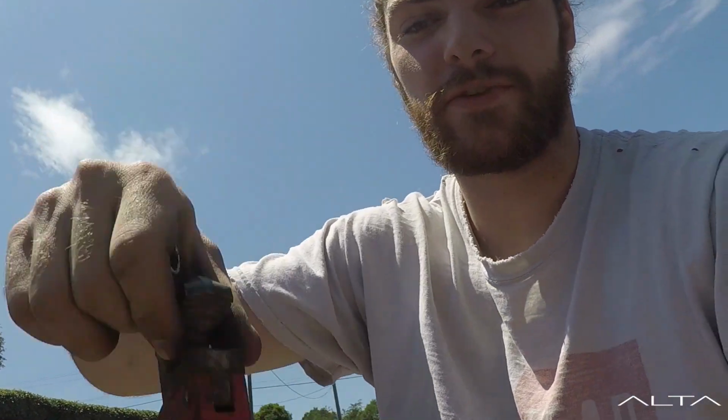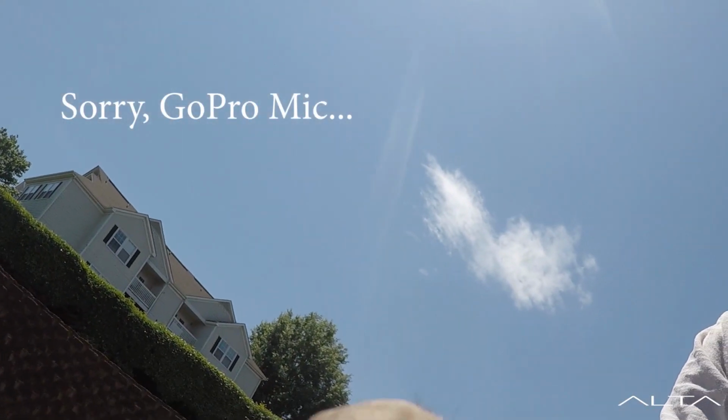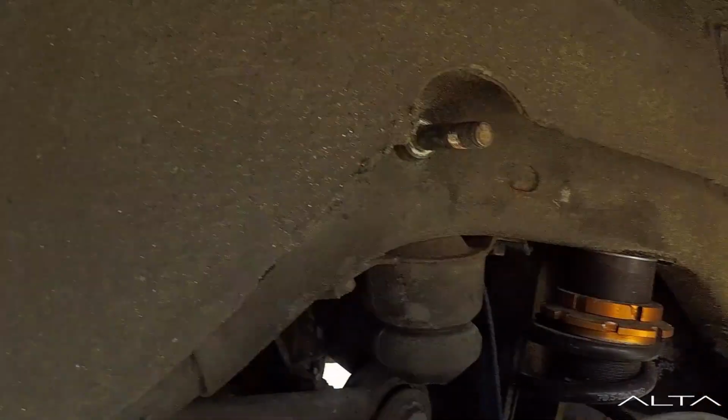Finally got that out. Ended up using a little pipe wrench to grip the sleeve and just twist it out. Once I got those out, I realized that the upper sleeve is pretty thick and too big, but the bushings that came with it are very, very close to the right height. The upper mount is just a threaded single shear bolt, while the lower has to be pinched between the two, so I need to use the lower mount, but the upper is less critical. Just replace the lower mount, not the upper. Just use the stock one that came with the strut for the upper.